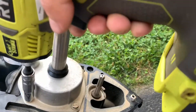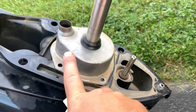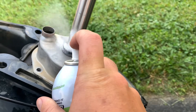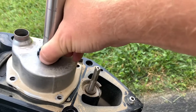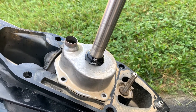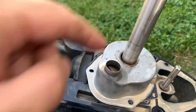The bolts are not very tight - when you're tightening it back up, don't over-tighten. In order to get this housing off, I'm going to have to get this seal slid all the way up off the shaft. It's a little stuck right now, so I'm going to put a little silicone lube on it because it's rubber safe. I'm going to try to save that seal and work it loose - silicone lube is good for everything. I wiggled that washer up off the shaft no problem.